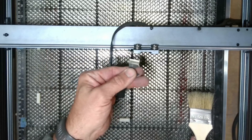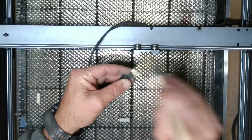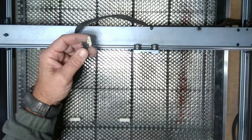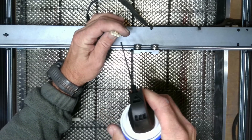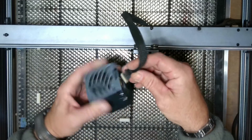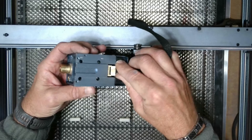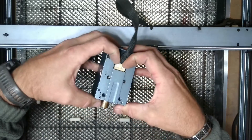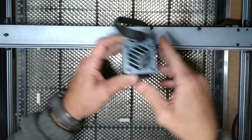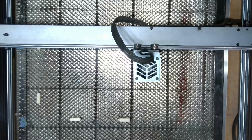For the last thing — this is our plug that plugs into the back of our laser module. You can see how filthy dirty it is. I'm going to hit that lightly with the brush, making sure it stays clean, then take my compressed air on it. Now here's our laser module — we're going to take that, get it plugged in until it clicks, and run our wiring harness back through there and plug it in.